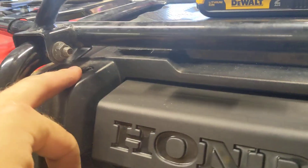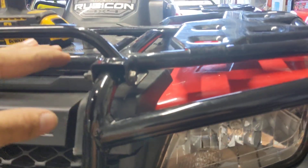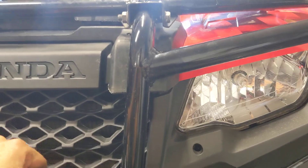If you do it this way, you don't have to mess with any wiring for your lights. Those same two bolts, and there are plastic clips here, here, and here. You can actually get those out with a flat blade screwdriver without removing anything else. Or once you pull the bumper out of the way, you can just tilt this up a little bit. Once you get all those out, it literally just pops out. Put your new one in the opposite way, throw your bumper on.